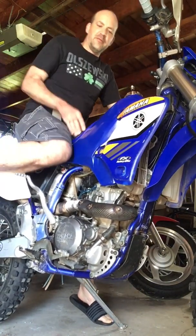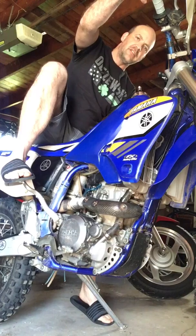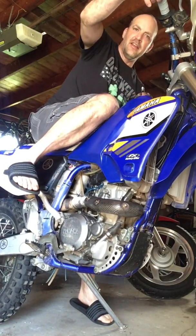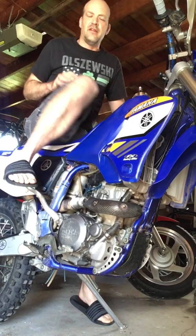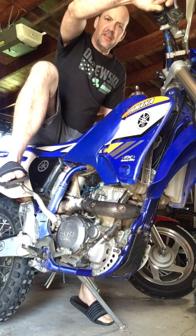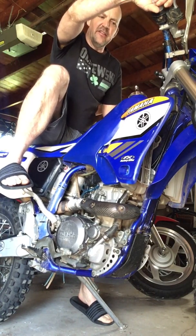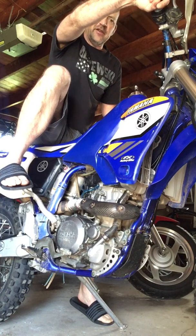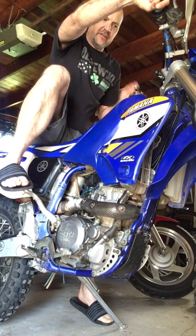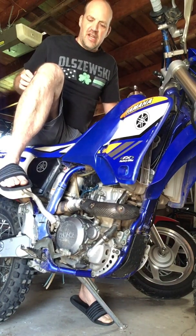So I'll swing over. I'm in my house slippers. I've got no choke. My fuel is on. Make sure it's on. Now what we're going to do is not give it any throttle at all whatsoever. The accelerator pump on this carburetor is really sensitive. All it really wants to do is utilize the choke if you're using it, and utilize the basics of the machine.